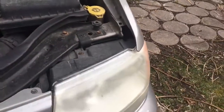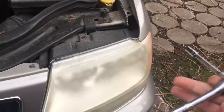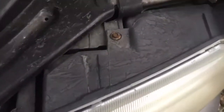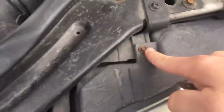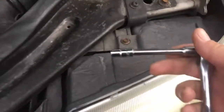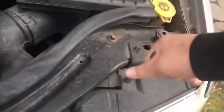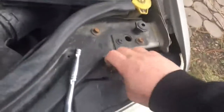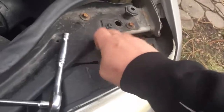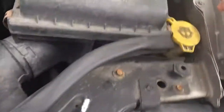We're back outside with the Jeep, and I want to show you how to remove your old one. You'll forgive my shoddy camera work — I'm only one person, so I have to do this one-handed. To remove the headlight, it is one bolt, seven millimeter. You can use a nut driver, ratchet, or even pliers, but I recommend using a socket — it's a lot easier and you don't strip the bolt. Go ahead and loosen it all up. Anybody can do it, it's pretty simple. As you can see, it's one very long bolt. Set that to the side so it isn't lost.